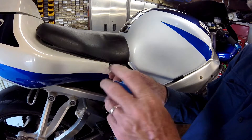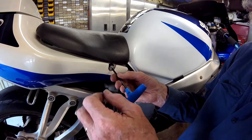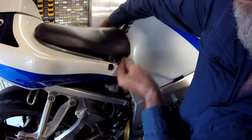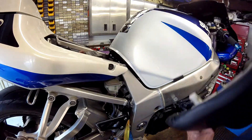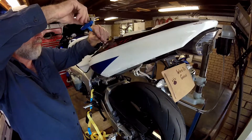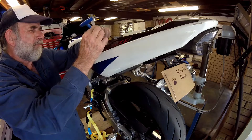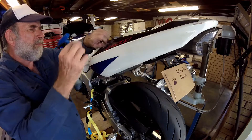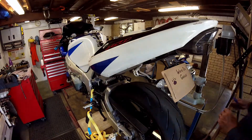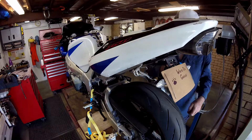The first thing I did was remove the seat. It was held in place at the front by two screws, one on each side, which I removed. It hooks under the frame at the back, so it was removed by lifting the front and pulling it forward and away. The tail piece is held in place by six screws, three on each side — two at the front which also hold the seat, one on each side just after the seat, and then two under the pillion seat or cover depending on what is fitted to the bike. The pillion seat or cover locks in place and you need the key to undo it.